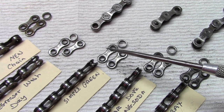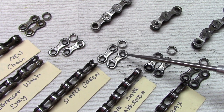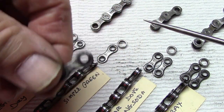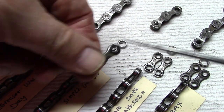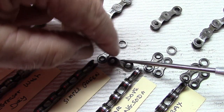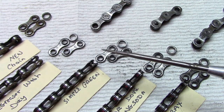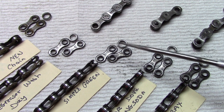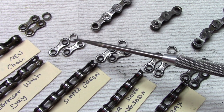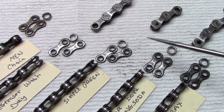The Simple Green result is similar, although it's not easily visible on camera — there's a little bit more dirt and grime, a minute amount, when we use the Simple Green, although the chain links look fine inside and out. So maybe the citrus might be a tiny bit better, but the Simple Green works fairly well.